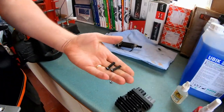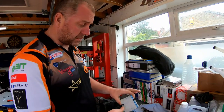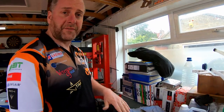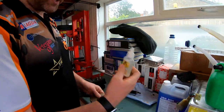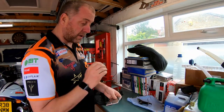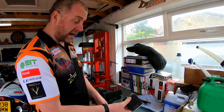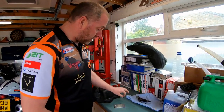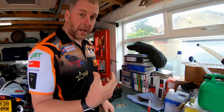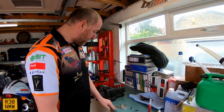Right then guys, it's been a couple of days as you can see - I've grown a beard. I've got the bolts, the nuts, spring washers, all that good stuff. What I've done is taken the liberty of bonding two of the bolts into the plate using Gorilla Glue, so everything is set and ready for me to film this part of the video and bolt it up to the bike. It's a bit Heath Robinson, I understand that, however it's perfectly good for what we're going to be doing here. The plate will bolt to the bike and then the reg/rec will be bolted to the plate just like so. The bolts going into the bike will have thread lock on them so they don't wind out.